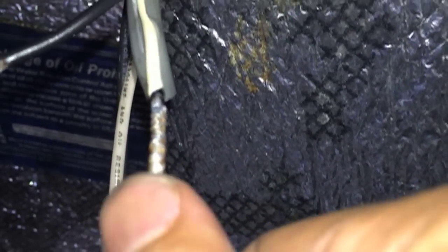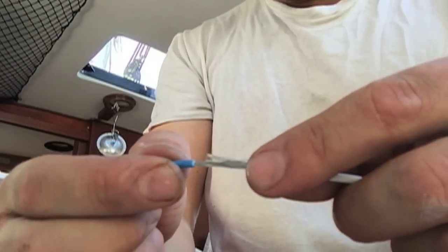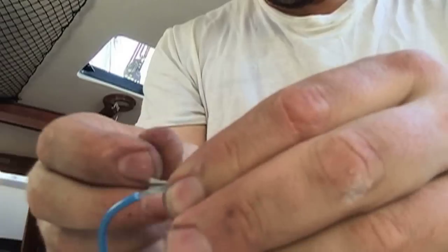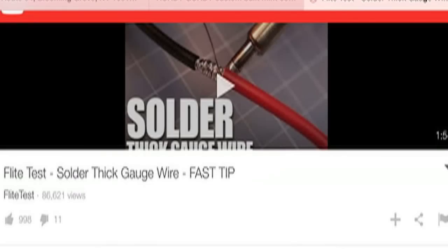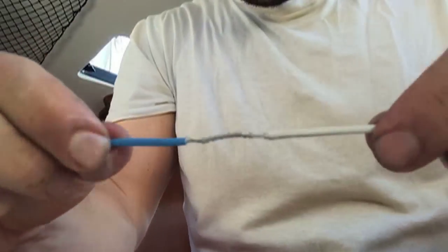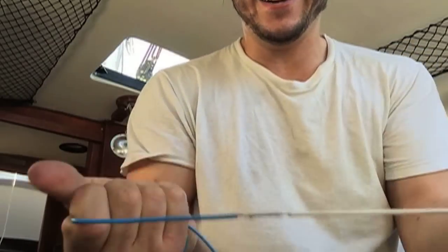I'm using this new technique I just saw on YouTube. They take the strands and leave them loose, kind of intertwine them, then twist them. They take a bit of wire and wrap it around. The YouTube channel was called Flight Test — it was for remote control airplanes. I wrapped it, and that's what we're left with. It's pretty attractive looking, and it's not even soldered yet — it's not going anywhere.